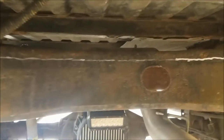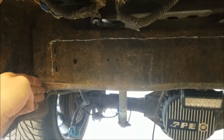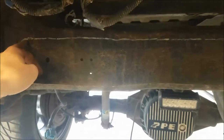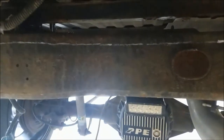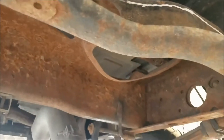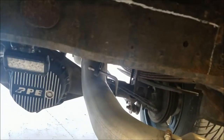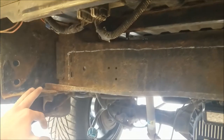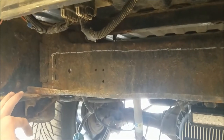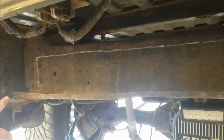Okay, so now that everything's out, per Big Hitch's instructions you have to measure up four inches from the bottom of the cross member right where it comes off the frame rail, all the way across to the other side, and you have to plasma cut — or use a grinder wheel or whatever you want — to cut all of that out. Obviously this is all for your spare tire area, though I don't keep one on the truck. So you're going to have to cut all of this out to make room for the new hitch to come in here, because it's going to sit right up in this area. I'm going to use a plasma cutter and try to take video of it while I do it. We'll cut this out, then grind it down and paint over all the raw steel to prevent it from rusting more.